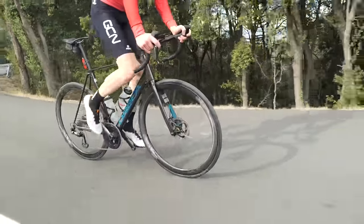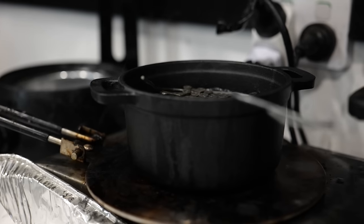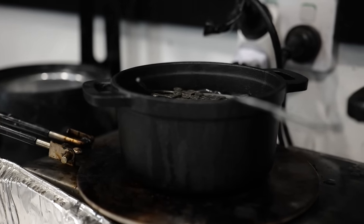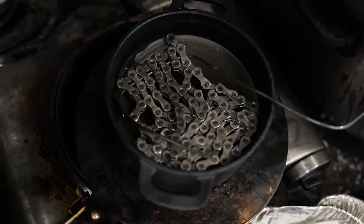Your chain is much more exposed and doing a huge amount more workload than your bearings, which get to spin quite lazily in a sealed environment. The chain is working like a bat out of hell and the lubricant has a really tough challenge trying to remain just lubricant and not becoming abrasive. Immersive waxing — apart from the fact that a solid lubricant for a part operating externally is a great starting point — is going to have the highest contamination resistance. Every time you re-wax you're putting your chain into a bath of hundreds of mil of lubricant, flushing out whatever small contamination has got in, and recoating the chain with a solid super slippery coating of wax. That's the goal — that's what you want.